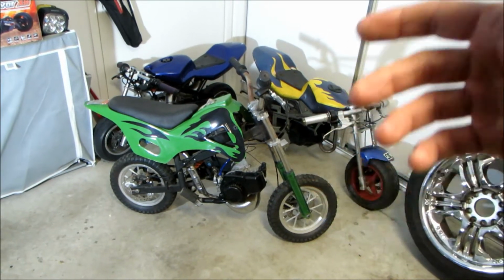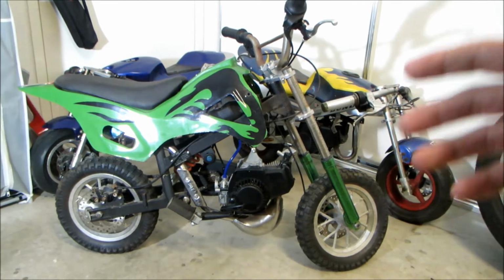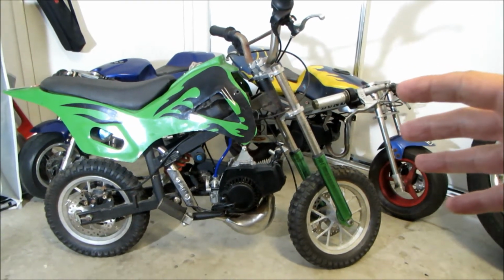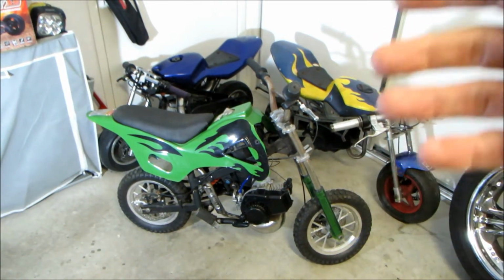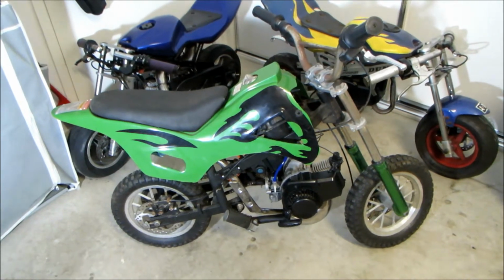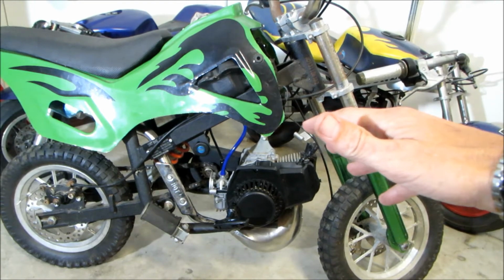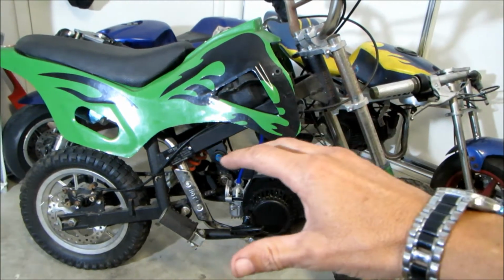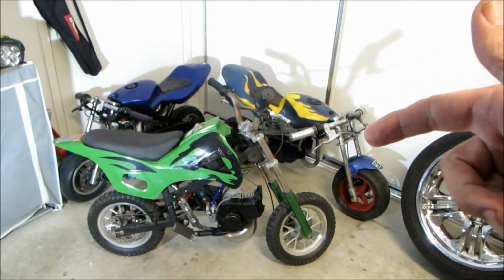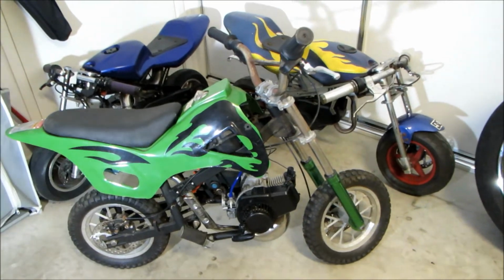I'm not sure if you've seen in the last episode of Skullcam, I tried to give this bike a cold start after it had been sitting for around 2 years. I literally put some fuel in there and tried to start it, and it didn't start. But now we've checked the spark, we know it's got spark, we've cleaned the carb, so there's no doubt that the bike should start this time. Well, at least I hope so, or there's going to be a part 3.